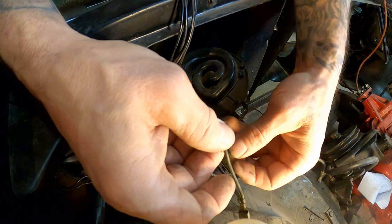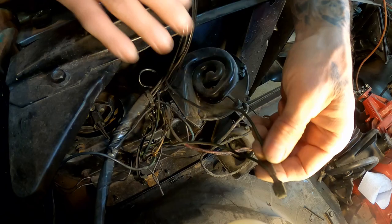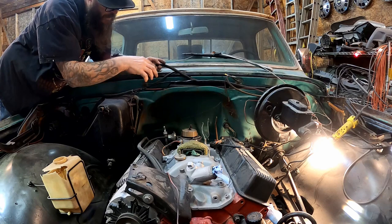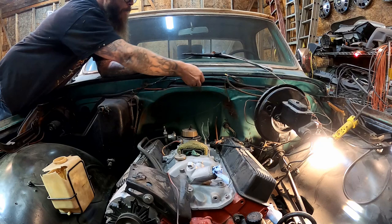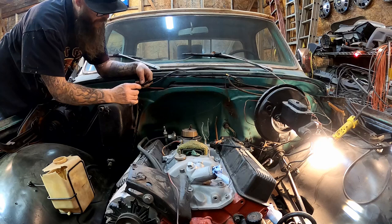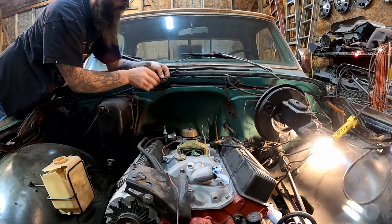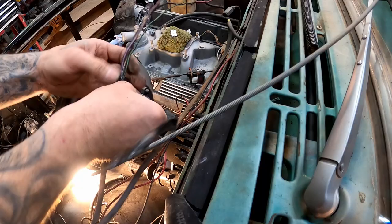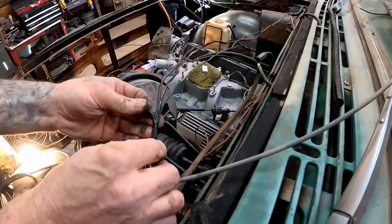So this is what we came up with — under that tape, just a whole bunch of melted wire and this plug that doesn't seem to go to anything. I'm going to cut open this wire loom. We had this open on the last video and got it all straightened out, but I need to go from here back — trace back some of these wires and see if I can figure out which one is supposed to go to the alternator. I already know which one goes to the distributor.